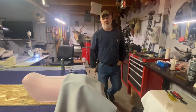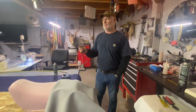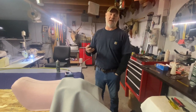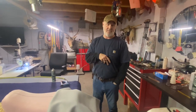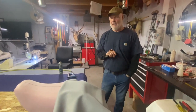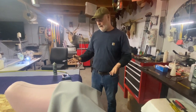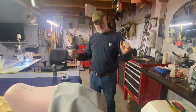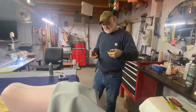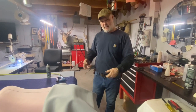Hello, this is Colt again, Spittin' Tax Upholstery. We're doing an ATV seat. We showed you how to put scrim, a topper pad, basically how to pull the staples, pull the old skin off. The foam was fine. We put a new topper down, this quarter-inch scrim, scrim side up so it's foam to foam. And I showed you how to tug it and pull it around and then leave a half inch, because that half inch will fold under the edge of the seat so it won't wear on the metal frame of the ATV.